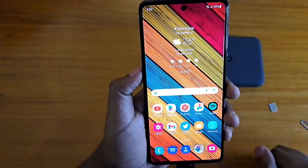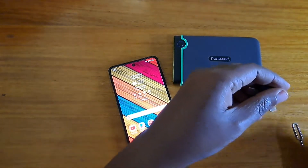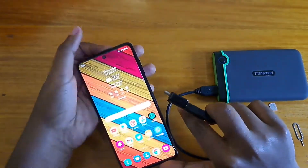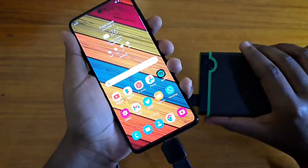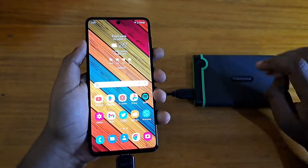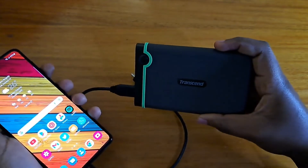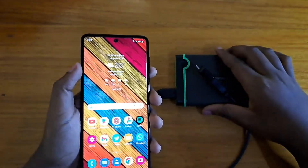Let's un-mount that and remove it, then test out the HDD. For the HDD, I'll need this cable — I'll connect it to this adapter and then to the hard drive itself. It seems like it can't quite connect. You can feel the hard drive trying to spin up, but I think for this to work you'll need a powered hub to spin up this HDD. Otherwise, you can connect simple drives onto this, but you can't really connect a full-fledged HDD. What's surprising is something like the Galaxy A13 can connect it — it is what it is.